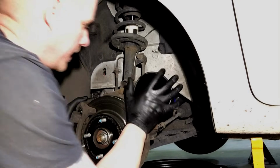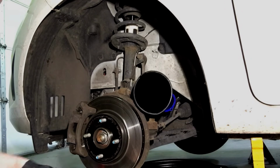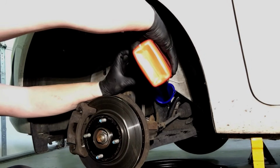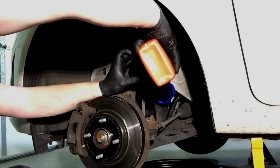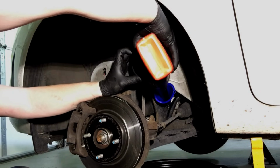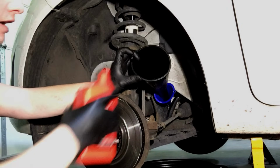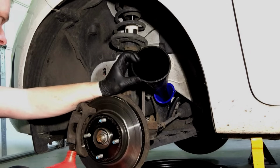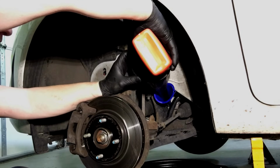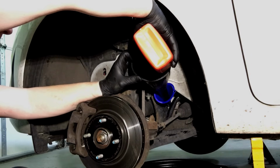Now once you have it deep down inside of there, our drain pan's underneath to collect the excess. We're just literally gonna fill it till it's overflowing, okay? So what you wanna do though is pick this up just a little bit and pay attention because it will flow out the end of the funnel. It's a funky little setup here. And like I said, right at 2 quarts it seems these things start flowing out the fill plug on there. So let's put 2 quarts in at first, nice and slow, and then we'll adjust from there.